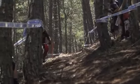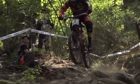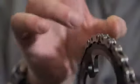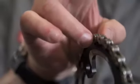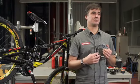For the perfect engagement of the chain on our X-Sync chainring, the process we developed for riveting the chain also allows us to have a super precise dimension on the outer width of the chain, and this way having our chain fitting perfectly on our X-Sync chainring. The big advantage of the XX1 chain is better performance, and it lasts 4 times longer than a 10-speed chain.